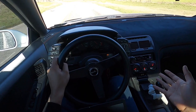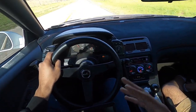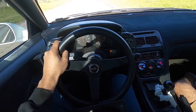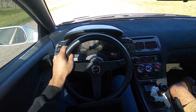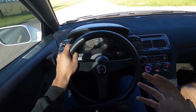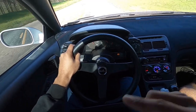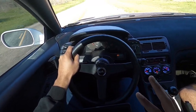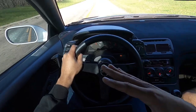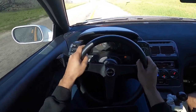I mean, you guys saw me just pulling away, I was shifting every 2 seconds. So on the highway, I'm ripping at like 4,200. Now that creates a lot of freaking heat. So much heat being created just by cruising, not even boosting, just cruising. Those cylinders firing as quickly as they are, there's a lot of crap happening there. So we bump that down to 2,000. That right there is gonna make a major, major heat difference as well.